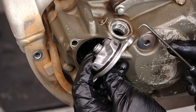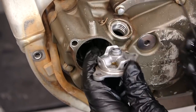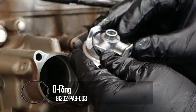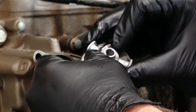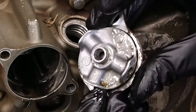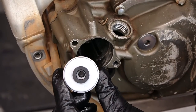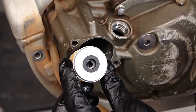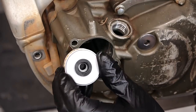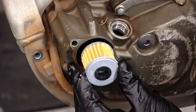If you look at the cap, you'll notice there's an o-ring — we're going to want to replace it with a new one. Now it's time for the new oil filter. If you notice, on the front of it, it's actually marked 'outside' and it has a black grommet. On the back side there's no grommet. You want to insert the oil filter with it outside facing out, of course.